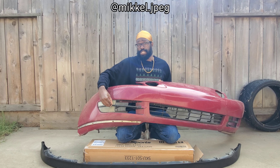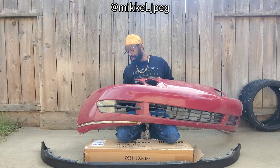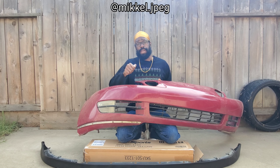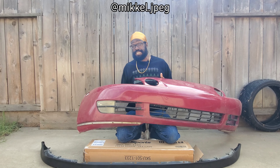On here where the little duct vent is right here, it goes across the fog light. Now this is an H3 fog light, just like your 97 and newer, but you cannot use the same grommet — which is the rubber piece in the back that plugs into the 97 — it's a different size. So remember that, but the plug-in will be the same.